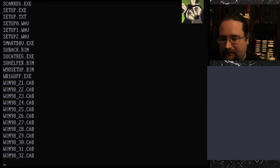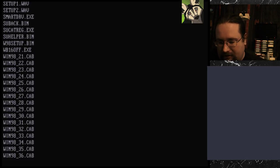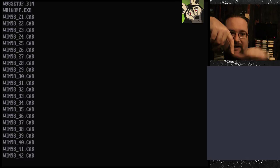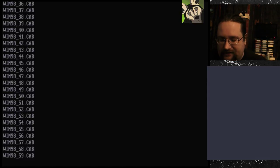What's interesting with this motherboard is later on I can probably stick an ATX power supply in there, and then you take the power button apart, and there's a little pin that controls it when you press it, sliding in and out. If you remove that little pin, it just becomes a momentary switch, and you can wire that onto the motherboard, and then bam, you have an ATX compatible case. But I think AT has its merits, and I'm going to stick with AT for now.